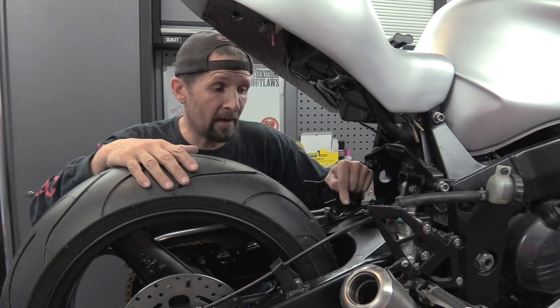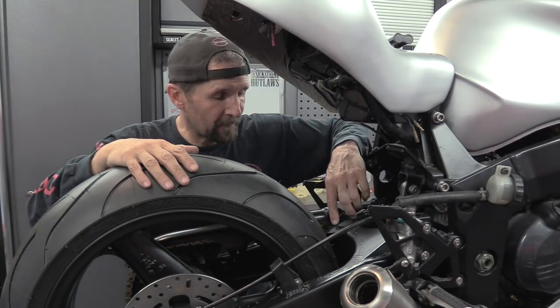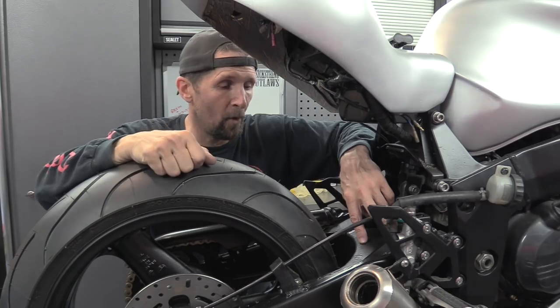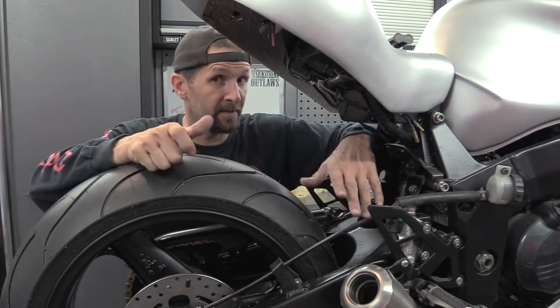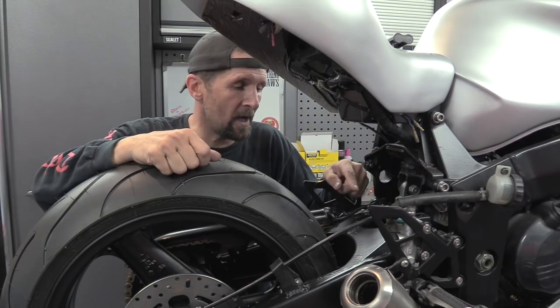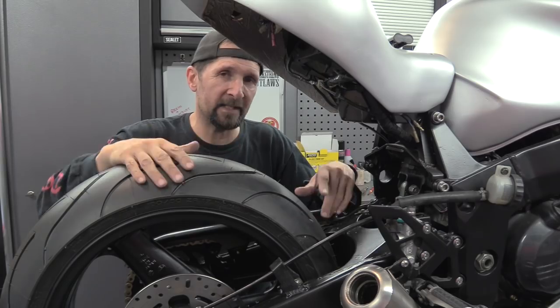So I don't know how thick it is, what I'm about to drill into, but at these two points on the outside, I'm quite close to the corner. I'm going to go M6, just 6mm thread, no more. So because I'm quite close to the corner, I might be drilling into almost solid metal, which is okay, that's absolutely fine, but I don't know. I'll keep an eye on it, drill them gently. They're aluminium, so I should drill nice and soft, and then I'll cut an M6 thread in, and we'll see how we go. Once I can get it test fitted, and it all fits, then I can paint it.